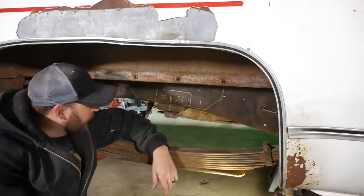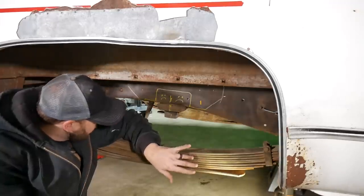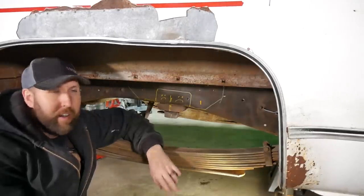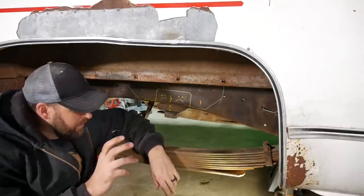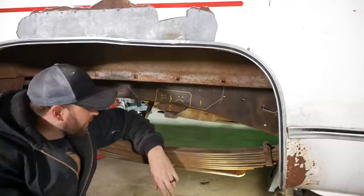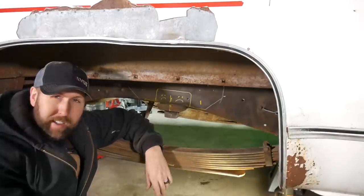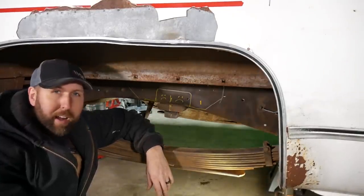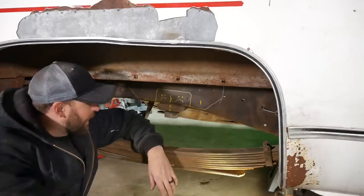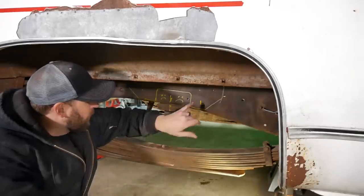Well, let me tell you a thing or two about a thing or six. What I did learn on the other side is I can't use the lightning scissor on the whole thing. I've got one 20 amp breaker that runs this entire shop, and I mean everything. So all my battery chargers and drill chargers and phone chargers and radio and lights and plasma itself, and I mean everything. So after I went through about $648 in 20 amp fuses and popped a breaker in the house 93 times, I came up with a different plan, which was, we'll take the gas axe and do the majority of the work, and then we'll come back with the lightning scissor and do the precision outlining and whatnot.